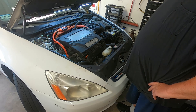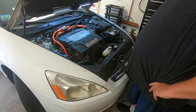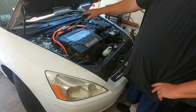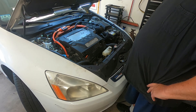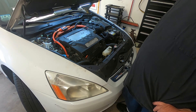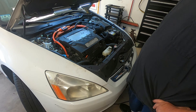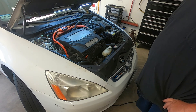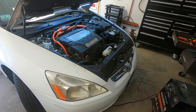That's really all I've got. I'm going to have to call them and give them the bad news. So just keep in mind, if you have a motor like this, do not touch anything to do with that orange wire harness. And make sure you have a good radiator cap — as simple as that. It's probably a $15 radiator cap that ruined this motor. Although the engine was down a couple of quarts, so I don't think the car was being very well maintained. I want to thank you for watching Rick's Garage. I'm going to post two videos — feel free to click on either one. And to your right, I'll post a picture of my avatar in the form of my trusty German Shepherd. Feel free to click that if you wish to subscribe.